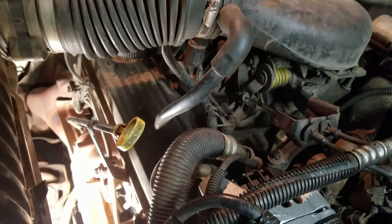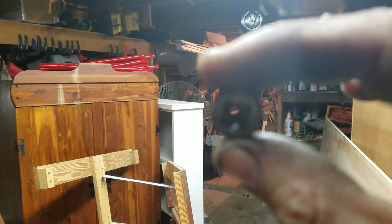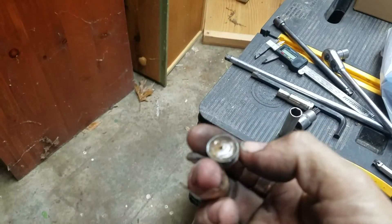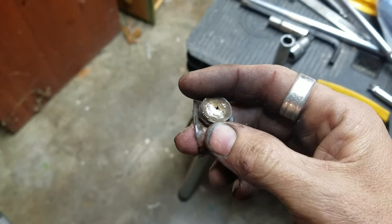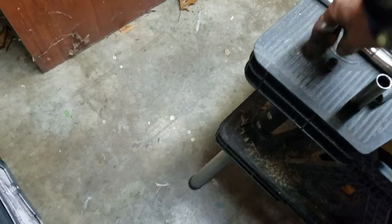Anything that's got the coolant temperature sensor on the driver's side going into the cylinder head. Here's what we did: we had a coolant leak. Owner says it's coming out of the passenger side cylinder head. Upon investigation, we discovered this plug is leaking — there's a hole in the middle of it. Never seen that before. It's not stock, and the metal is way too thin — looks like it chemically deteriorated away. No clue what's in that coolant, but it rusted through the center and started leaking.